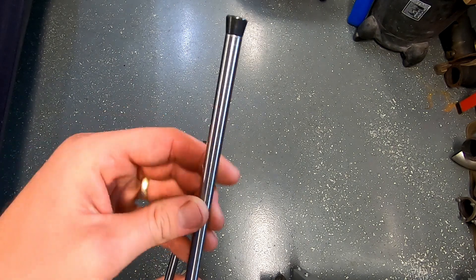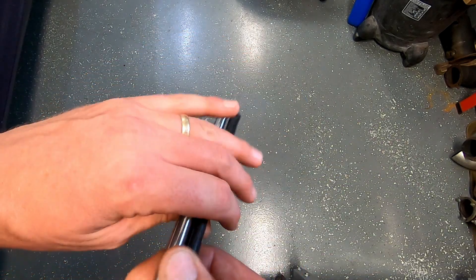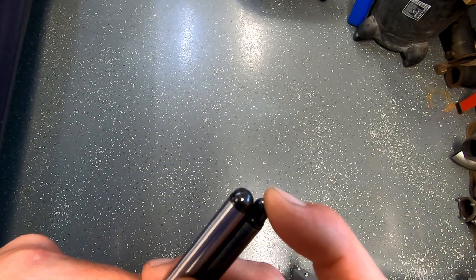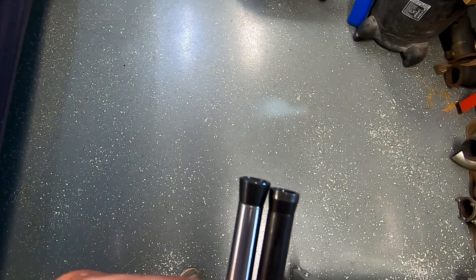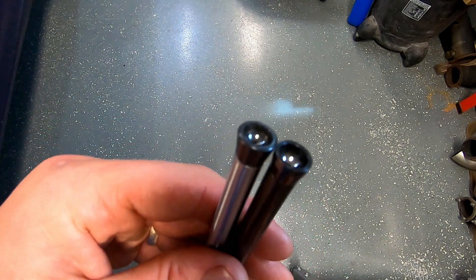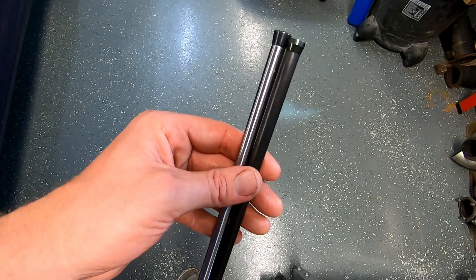Here are a few reasons why the longer pushrod — which when we measured was about 125 thousandths longer — gave us less lift. The only way we had of measuring was from the outside of the cup to the very tip. On the small end, the round end, it's a finer tip, so it could go a little bit deeper into the solid roller lifter — that could make a difference. The other thing to account for is the depth of the cups, because you can clearly see two different kinds of cups. They both take the same engagement nut on the rocker arm, but there could be a different depth there. So combining those differences, this pushrod is at least 100 thousandths longer and it is still slightly too long.